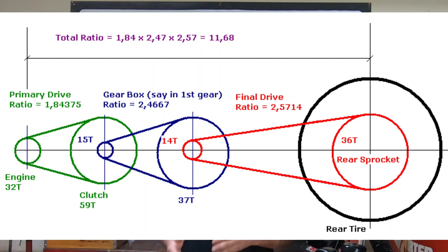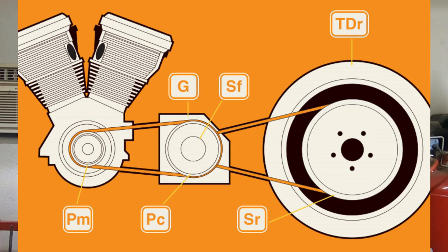There are a lot of different styles out there — there's just straight up sprockets, or the one I personally prefer is the Dark Horse Man of War Compensator Eliminator. This has basically a rubber cush drive in it so you still get a little cushion, just like the rubber dampeners in your rear wheel — you've got the same thing up there in your primary. Here's the other good part about going with a compensator eliminator: this is an opportunity to play with your gearing a little bit. You can go up or down a couple of teeth. You want a little bit more on top at lower RPM — you'll give up a little on the bottom, but running down the highway in sixth gear you'll pull lower RPMs.